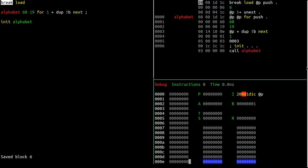So here's the entire state of the machine. Here's all the registers, the data stack, and the return stack, and part of memory is shown to the left. What happens to start with is it fetches through the P register from block 0 an instruction word and begins to execute it. Here it itself does a fetch P that fetches the next instruction word, still just streaming in from block 0 though, not from memory. Puts that on the data stack and then pushes that to the return stack.